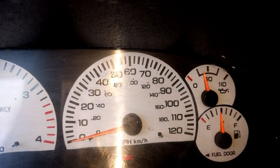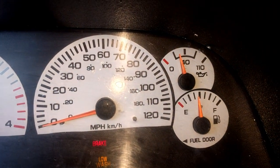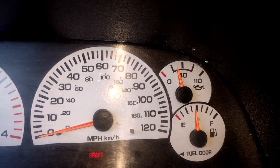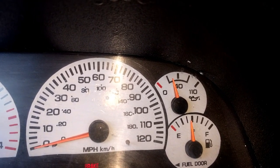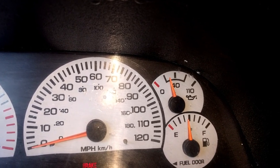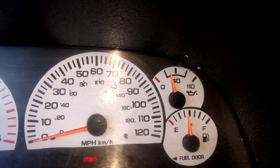Looks like we fixed our problem. That looks like pretty decent idle oil pressure — this is saying 18, 19, 18, 19, which is acceptable. I think I'm going to go ahead and get a sending unit anyway and stick it in there. I know it's $200, but with an engine that's almost 500,000 miles on it, you don't want to complain too much. Anyway, I hope this can help you with your problems. Be sure to take a look — I've got a lot of other Dodge Cummins videos, and I also have some BMW videos if you like those. Have a nice day, and thank you for watching.